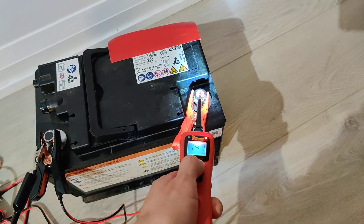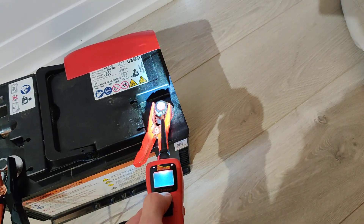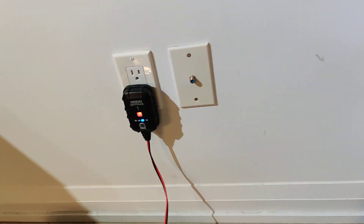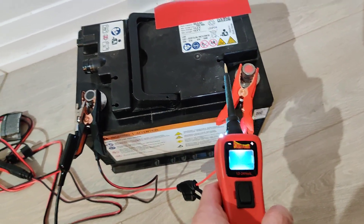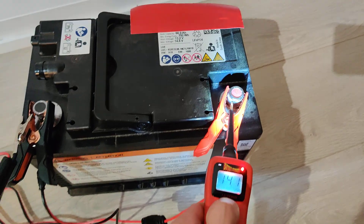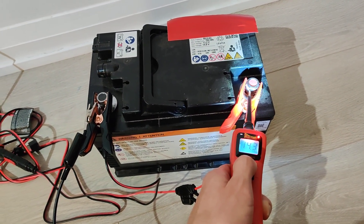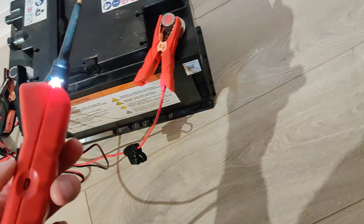We're going to do that right now — apply some voltage and hold it until this comes back to life. As you guys can see the battery is now alive, so I'm going to let go. You've got to do this a couple of times — apply power until your battery is able to charge by itself, because right now it's trying to go but you just got to hold it for a little bit until the battery gets enough voltage to charge on its own.